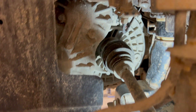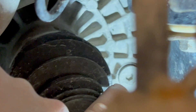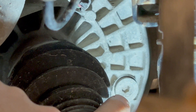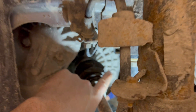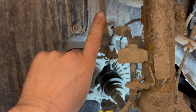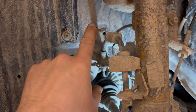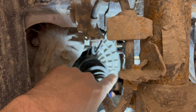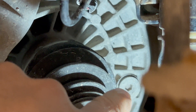With the tire out of the way, if you look back just behind the CV axle right there, that's the fill plug — that's where you're supposed to fill it or at least check the fluid. You can also fill it through a vent up top, which I'll show you later. When fluid runs out of that hole, you know it's full, but you can fill it through there too.